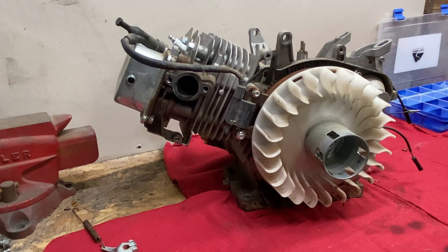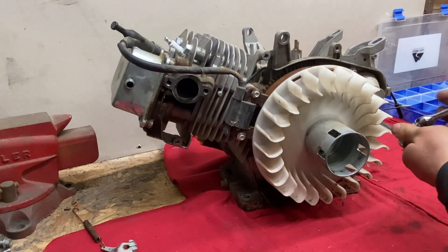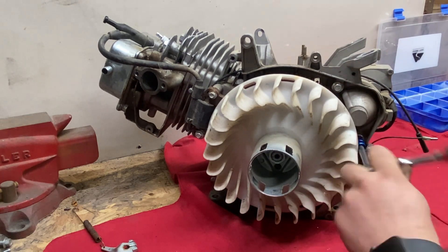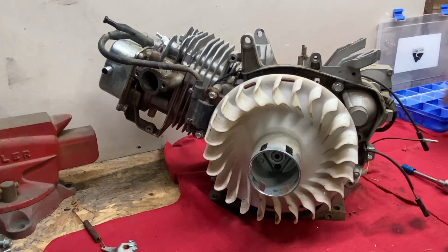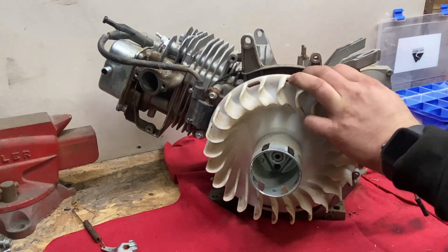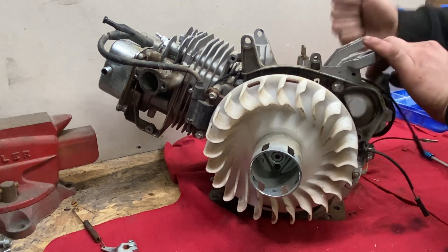With the arm off, we're going to go ahead and remove the starter. This is held on by two 10mm bolts. This bottom bolt fought me the entire way out and as you can see the amount of rust and corrosion — that would be the answer why. This top one came out with ease and that one is spotless. Give the starter a little bump there and it will come right out.